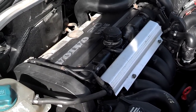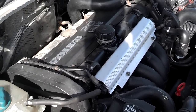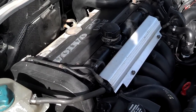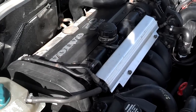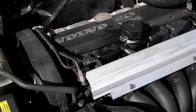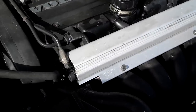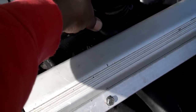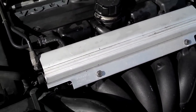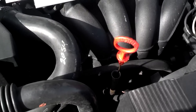Number three — check the serviceability of your PCV system. That means positive crankcase ventilation system. This system is a little unique to Volvo cars, but it controls emissions and circulates gases through the motor. If this system is clogged, it can cause pressure to build up in the head and block of the motor, causing major oil leaks. A rear main seal oil leak can be an end result, which is a very expensive repair. You want to check this hose here — if this hose is hard as a rock, chances are it hasn't been replaced in a while. If the car is warm and running, sometimes you can pull the dipstick, and if you see smoke coming out of the dipstick, it's probably in need of servicing.